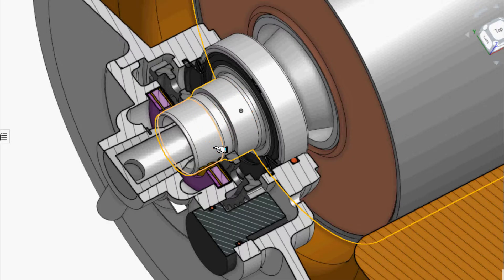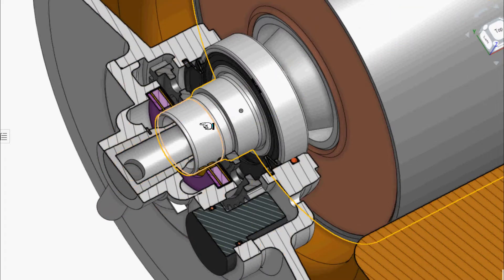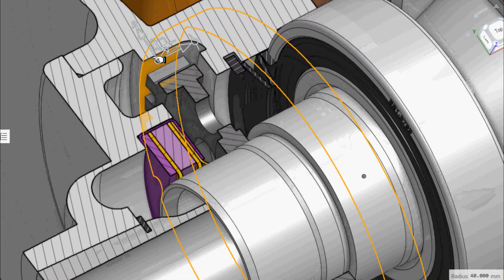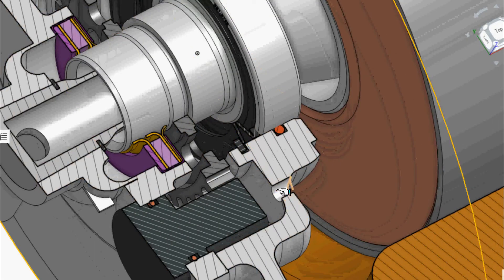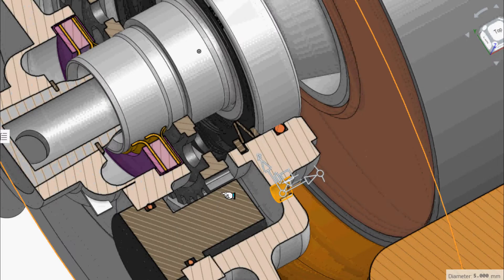Back to the origin: the coolant leak. When the seal leaks at a couple thousand RPM, the coolant can seep along the entire circumference of the shaft. Centrifugal forces will push most of it away from the shaft along the seal and the reluctor wheel, so the wheel acts like a centrifugal pump. The fluid will hit the interior chamber wall all around, then gravity will pull most of it to where the drain will be. However, part of the coolant may splatter around and drain into the rotor chamber through this 5mm hole behind the speed sensor — that's the reason to close it.